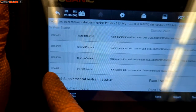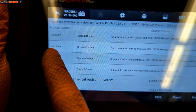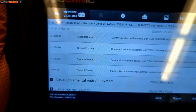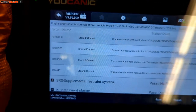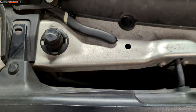The fault codes are U1444E1, U105CFA, 105CFB, and 105CFC. This is sometimes called the Distronic on Mercedes — it's the system that will beep at you and apply your brakes if you're getting too close to a vehicle.